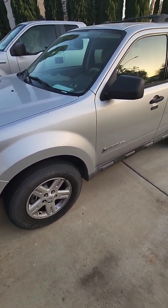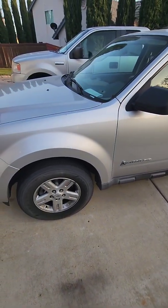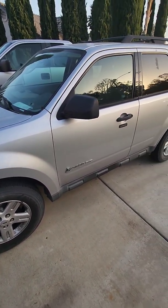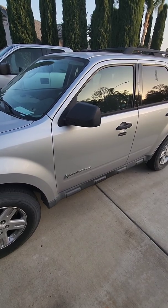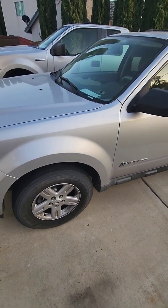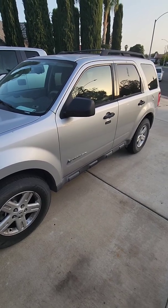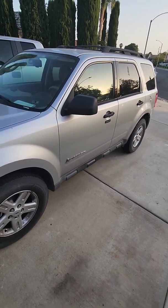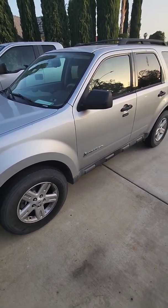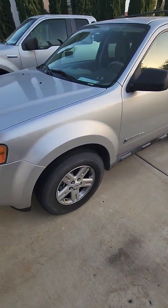On this car, I did have a little glitch, and I mentioned that in the description of the video. Once I finished, I pumped the brakes up and took it for a little test drive. But the check brake system light was on, and then the stability light was also on. I'm like, uh-oh, great. It's a hybrid, something tricky that I didn't know about is going on. So I drove it around a little bit. I even shut the engine off a couple of times while I was still driving it, and then started it before it stopped. Didn't make any difference. So I drove it around for about 5 minutes. I pulled it back in the driveway here, shut the engine off, and then started it right back up.